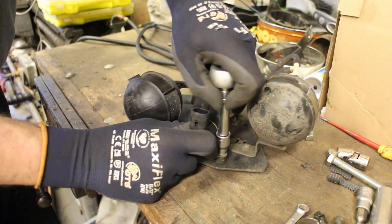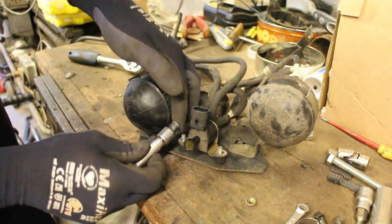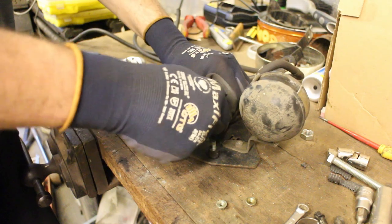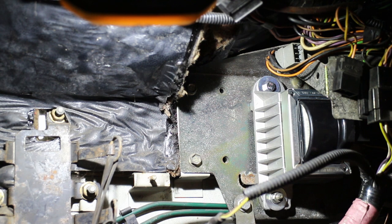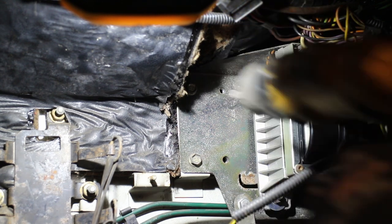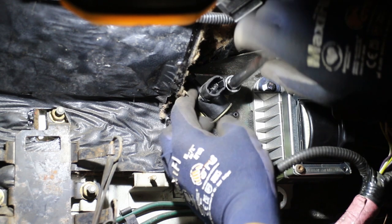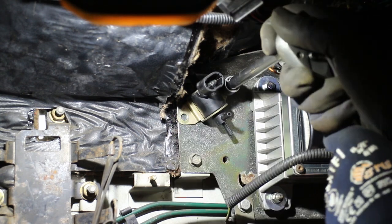This sensor is also needed on the 2.2 engine, so I'll salvage it from the old 1.7 pipework. I say sensor, I think it might be a solenoid actually, but I'm not sure. Perhaps someone can correct me on that. I looked at a few options for bolting it on and settled on using an existing hole which just needed tapping out to accept an M6 bolt. Now there are two air hoses which connect from this sensor to the inlet manifold, but I'll tackle those later on when I sort the rest of the hoses out.